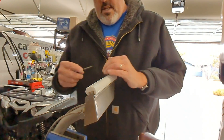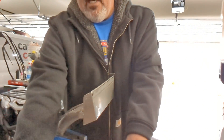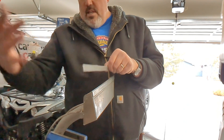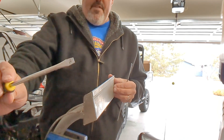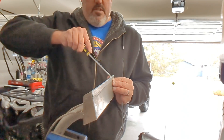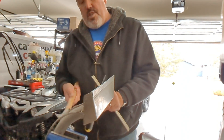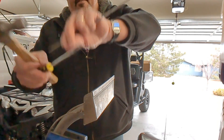Take that lip off and it's going to be a whole lot easier. To get it off, it's just a pressed-on fit. You could take the front or back off. You've got two options: you can take the front one off with a big flat-head screwdriver and basically pry it upward — you can see it starting to go. Or from the back side, put it under the lip, take a hammer, push it upward. It'll take a couple of whacks, and as soon as you get it lifted, get the screwdriver under there, push it forward and it'll peel right off.